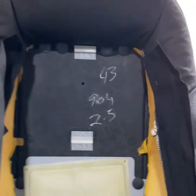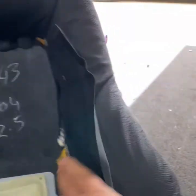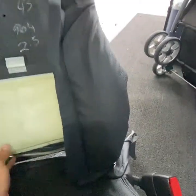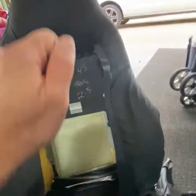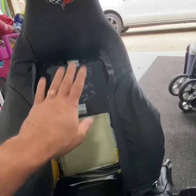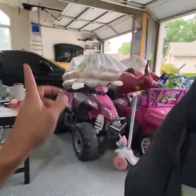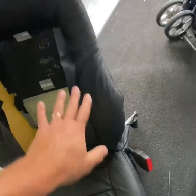This is the crucial part. You're going to do one side at a time. I do have my zippers on the back side of the seat basically 75% closed - that's where I made my first mistake. The first time I overstretched and allowed no room for the zippers to zip all the way down, which led me to taking the driver's seat to an upholstery shop to replace the zippers.